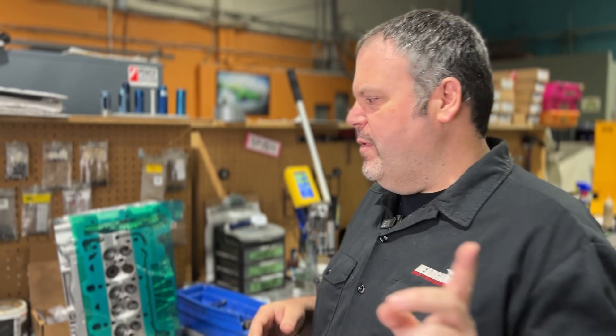Reusing the valve keeps us in the stock spring height. The problem with the stock spring height was that nobody makes a valve — and they also don't make a spring. These guys have been using a spring kit that was not made for this, and nobody measured. Nobody knew what kind of spring pressure they needed. They were using something like 83 pounds on the seat, 78 on the exhaust, and like 180 on the open — which is not going to be good for 1,000 horsepower. You're going to need something pretty badass, over 100 pounds on the seat and like 200 open.